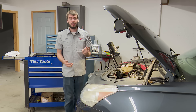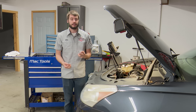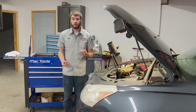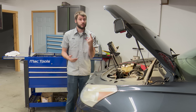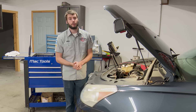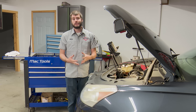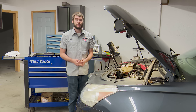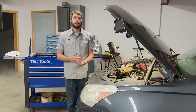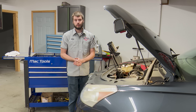Make sure your smoke machine is rated for testing EVAP systems. Make sure you seal up the system by closing the vent solenoid. Make sure you verify the purge solenoid is okay, and make sure your smoke machine is working with smoke flowing through the entire system. That's how you'll produce a repeatable, accurate smoke test. Then always very carefully look at the system — if it has a leak, you'll find it using a smoke machine 99 times out of a hundred.